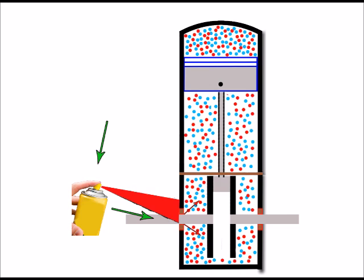So in the past, when I've had bogged down issues, when I've pulled the trigger on the throttle and it started to go, what I've done is I've sprayed it with light oil, and if the engine revs have raised again slightly, then it's indicated to me that it's drawn in oil through them seals, and I know then that them seals are leaking. That's what I've done in the past, and it's worked for me.